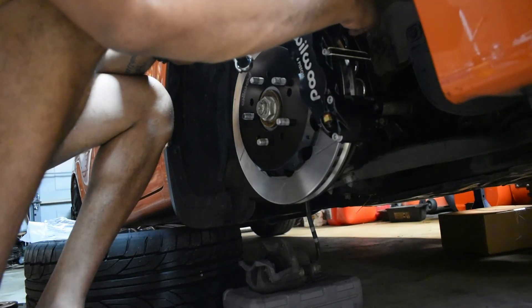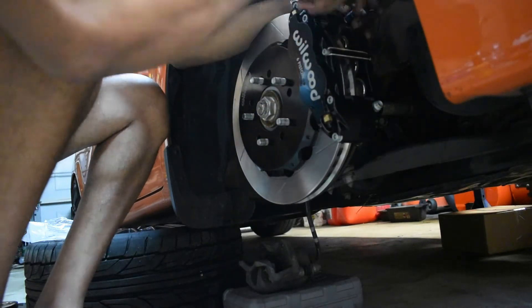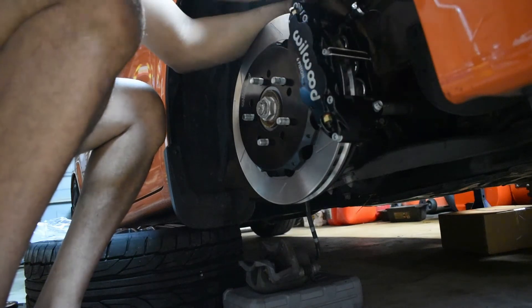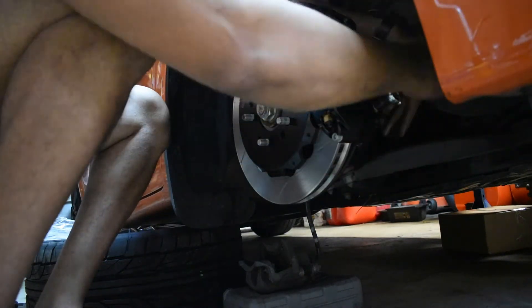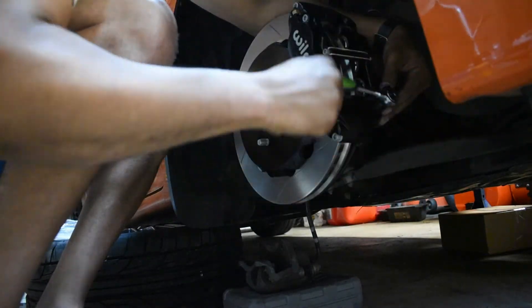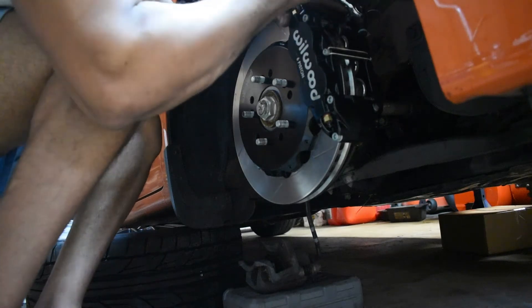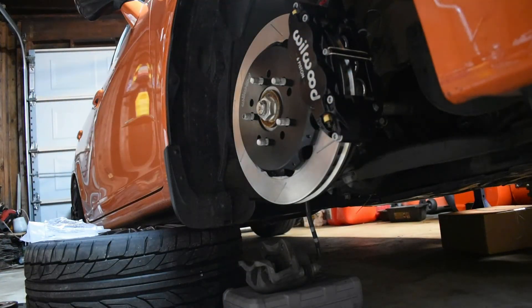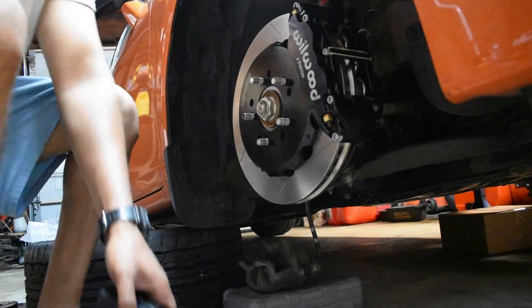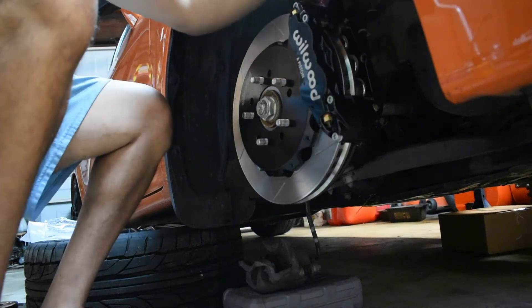These are the bolts that hold the caliper in place, with a washer. I didn't take note of which socket I used, but it should be around an 11 to 12-millimeter 12-point socket — make sure you get a decent set of 12-point sockets. I'm using a Husky set from Home Depot, cost me about $15 for the set. Tools are expensive, but you don't have to get them all at once. I stay away from some Harbor Freight tools, but in a pinch they work and they've gotten me very far.